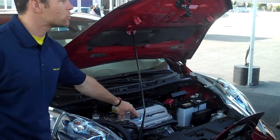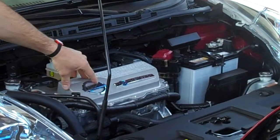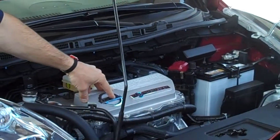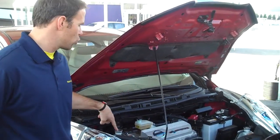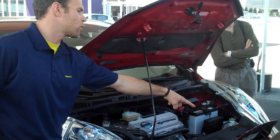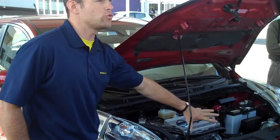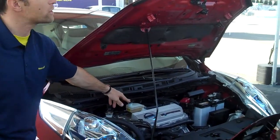That's wrapped in a water jacket. There's a water jacket around the inverter back there, and there's a water jacket around the electric motor. All those need to be kept a little cool because they do get warm. So you've got coolant here, another coolant cap over there, and a coolant reservoir right there. You do have a radiator in the car — that needs to be flushed every 120,000 miles or so.